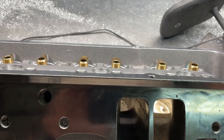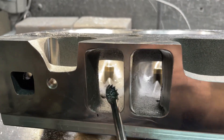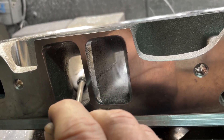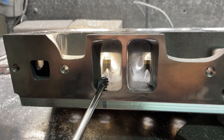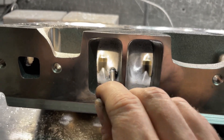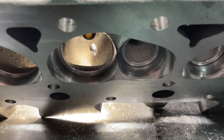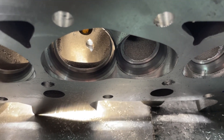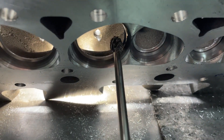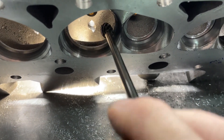Then I flip it back around. If done correctly, the short side would be done, this side would be done, and I would see the lines for porting. From this view, I start blending in the roof to this side and that part's finished. I've touched the apex of the short side but not so much the shape yet. Pretty much from here all the way forward would be done. Then one more flip for the final view — from there I work the short side itself, making it lean back properly and blending it in with the seat.